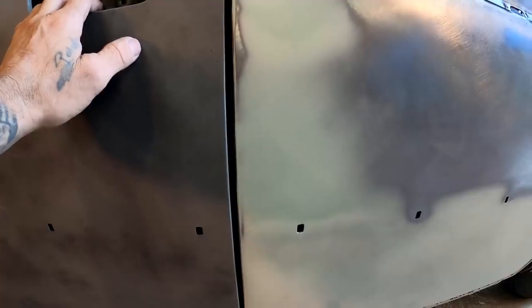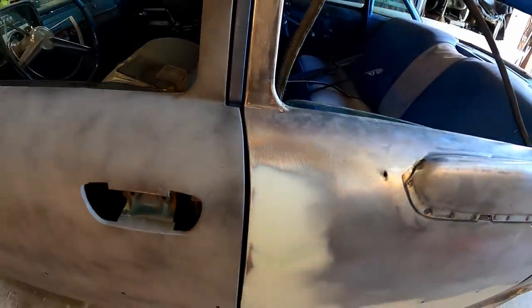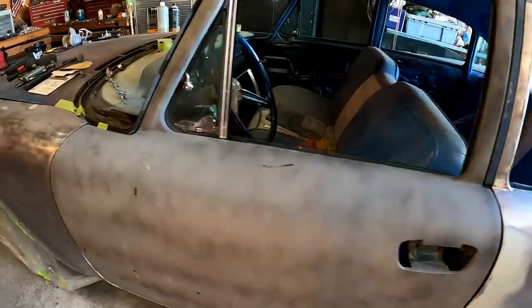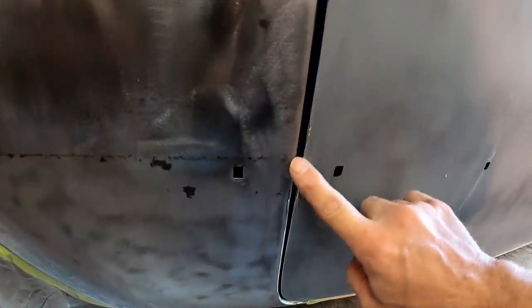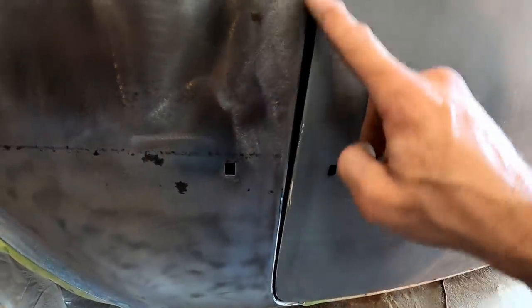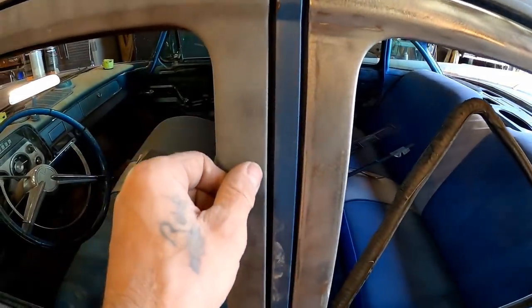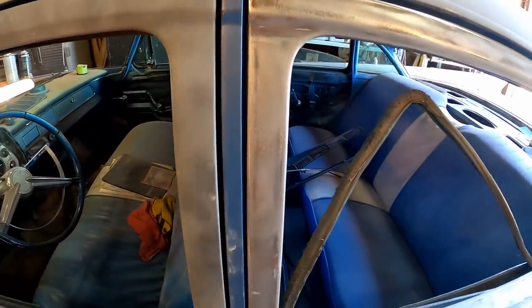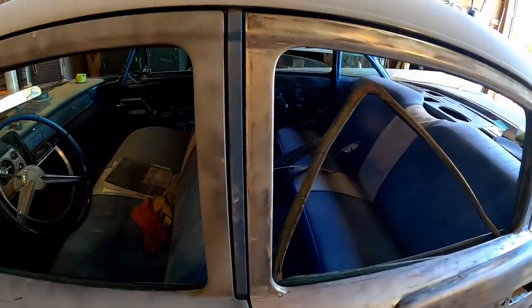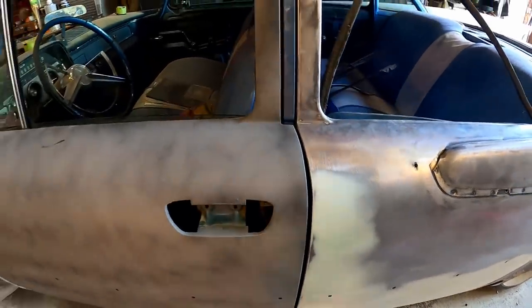Like I said, 5 millimeters is kind of what we go for on these older cars. Man, I would be much happier with it about like that though. But oh well, if I have to, maybe I'll bump it back. The only problem with bumping it back, we're okay up here. We could afford to go back just a tiny bit. But like I said, you're going to end up closing this gap, and this gap is perfectly matching the other gap. So I don't know. We may split the difference. We'll sacrifice a 16th there to close that up a 16th, and maybe that'll get us what we need. We'll figure that out in a minute.